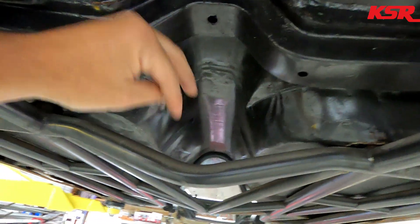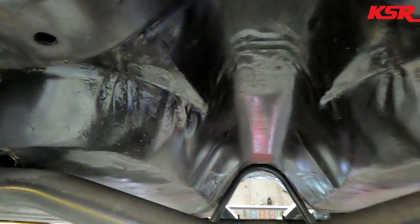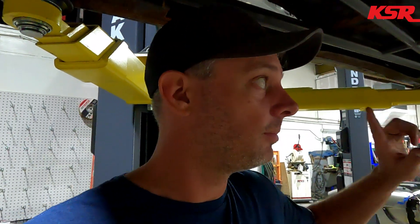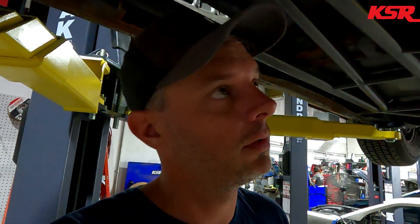There's rusting, and this is way too low — with the car at ride height it's going to hit the drive shaft. That's going to have to go. I want to do a full drive shaft tunnel enclosure, which is a whole lot safer if the drive shaft ever lets go. I do have a carbon fiber shaft for the car, which I hope is still the right length because I've ordered a Turbo 400. I'll probably put the nine inch rear end in the car and use the drive shaft I have to set the engine placement, or maybe I just end up buying a new carbon fiber drive shaft.